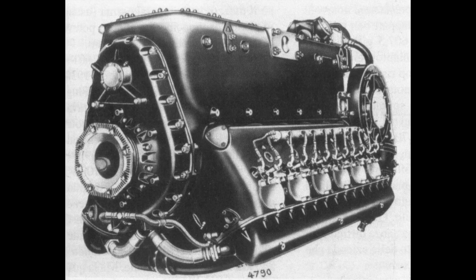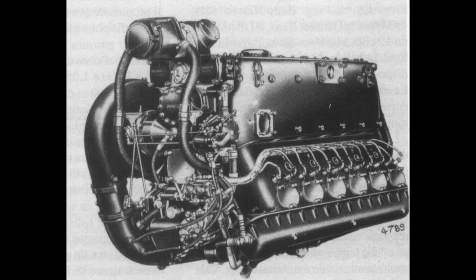The Alfa Romeo Monsone was equipped with highly sophisticated automatic adjustment devices. After all, it was an engine with direct fuel injection. We know that the advantage of such an engine is that of a uniform distribution of fuel to the individual cylinders, and therefore a consequent saving of fuel and an increase in the available autonomy. In addition, there was the elimination of the danger of icing, which often occurs in carburetor engines, as well as the consequent fire danger.